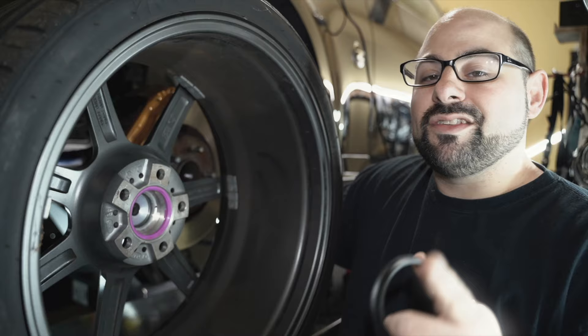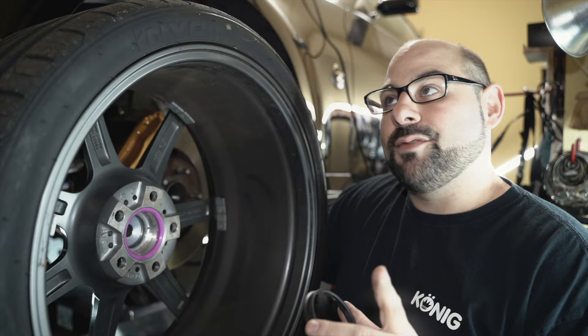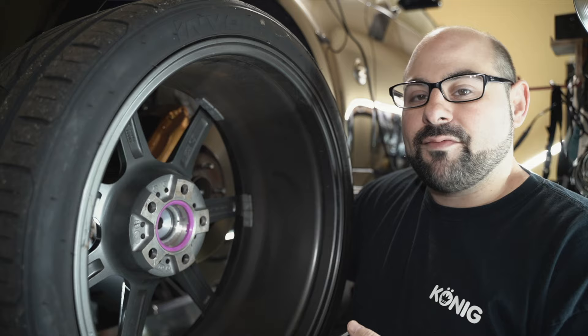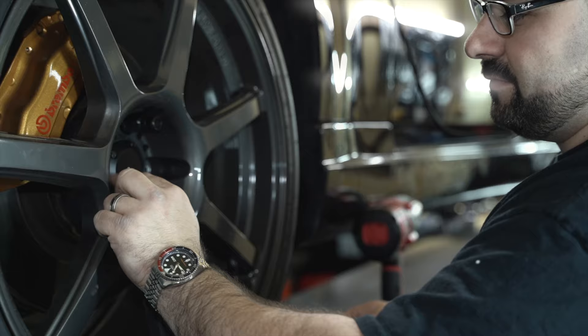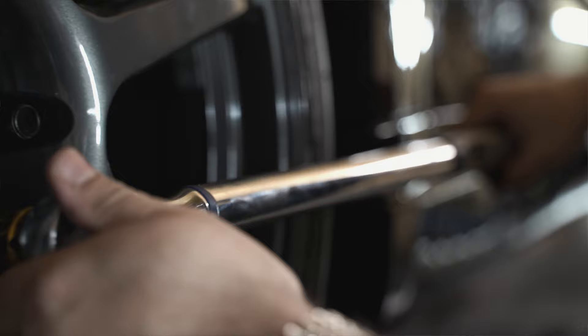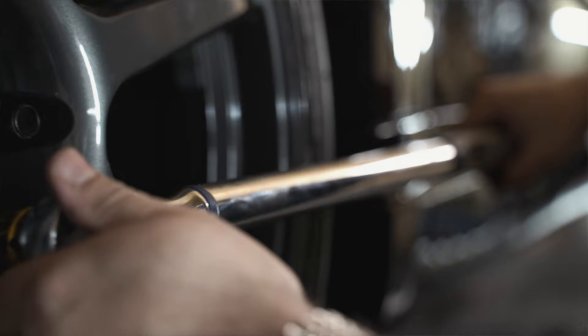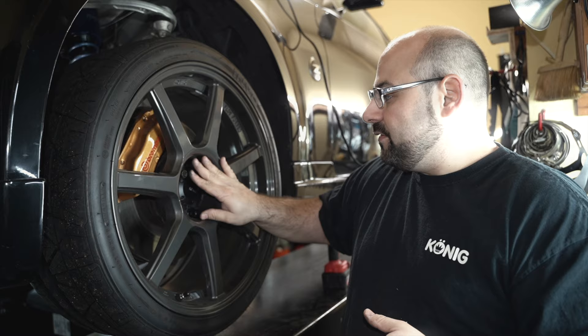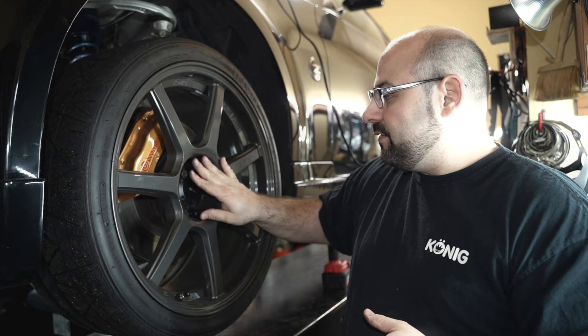You could put it on the hub, but a lot of times people damage hub rings when putting the wheel onto the hub because of all that weight to handle. Our rings are color-coded according to size, so with this fuchsia ring we'll go ahead and install it. For a five-lug pattern, you're going to go in a star pattern. We're not going to use an impact gun — we're going to use a torque wrench. Once the wheel is on the ground and the lug nuts are hand-tightened, we'll torque them with a torque wrench.